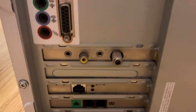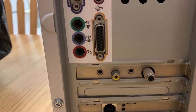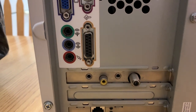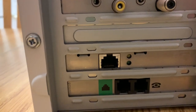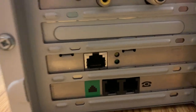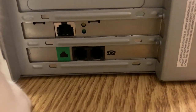Things I added in 2002: a tuner card with NTSC tuner and composite input — the cheap $49 card, but it has the common Brooktree chipset and I can run better drivers on it and do capturing. Down below is a 10/100 Linksys ethernet card, and that was when I first got cable internet.